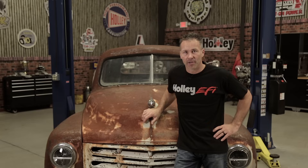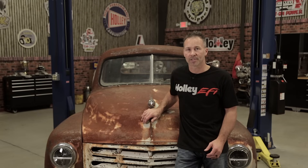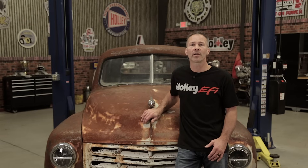All that's left to do now is drive the vehicle and let the system perform its self-tuning process. The best way to do this is to drive the vehicle under as many different operating conditions as possible — different engine speeds with varying loads. Start by slowly revving the engine in neutral and holding it at different speeds all the way up to 2500 RPMs. This will help the system learn these different points. Then drive your vehicle, possibly using different transmission gears and allowing it to learn in different areas. If you have an automatic transmission, you may want to put it in gear and with your foot on the brake pedal, apply a small amount of throttle so that the system learns in this area as well. All that's left to do now is drive your vehicle and enjoy all the benefits that Terminator X and X-Max can offer you. If you'd like to learn more about Holley's Terminator X and X-Max engine management kits, visit our website at Holley.com.